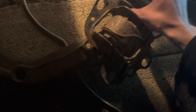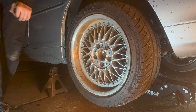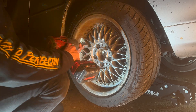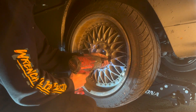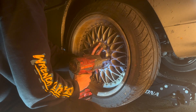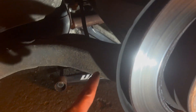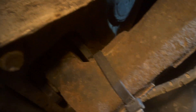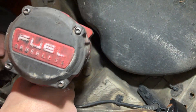This is something that pretty much anybody should be able to do. If you have an impact wrench, it makes your life so much easier. To find these, you follow the trailing arm straight back and there are those three bolts — they are that easy to get to. As soon as I do this my alignment is off, so there's no going back.